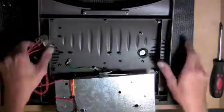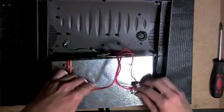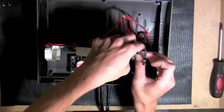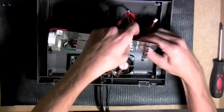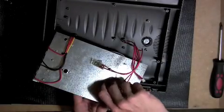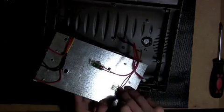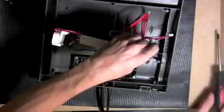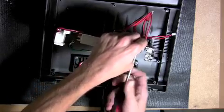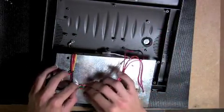Install your LEDs into your heat shield reflector assembly. Using a Phillips-head screwdriver, mount the LEDs to the new heat shield reflector assembly using the screws and nuts that were provided with the original reflector. Be sure not to over-tighten the screws to avoid cracking the LED circuit board. Repeat the same process one more time for the second LED moonlight.